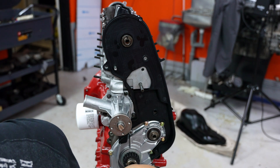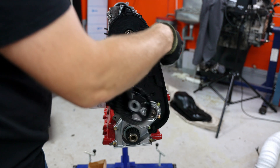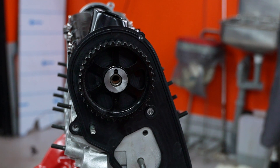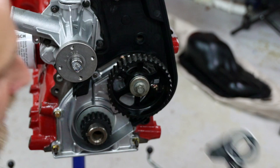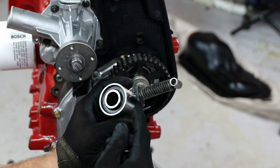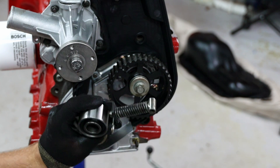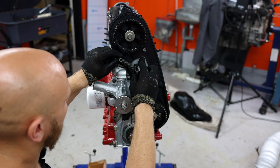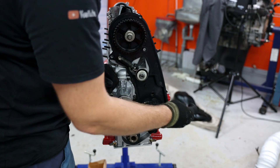Let's put the wheels back — the wheels are the same, you can swap these out. We'll start with the top one here to the cam, we should put some thread locker on here. Then we'll get the one for the oil pump drive. I've got the new tensioner — I've already prepped it by putting this spring on here, just clamped it up in the vice. There's a washer for that — this drives the oil pump.